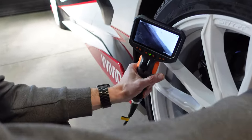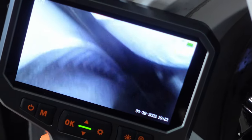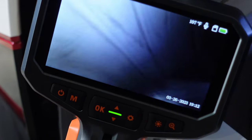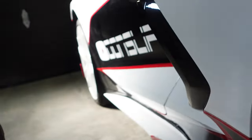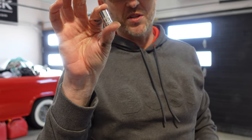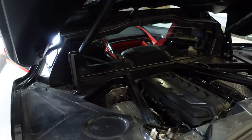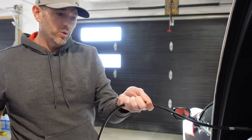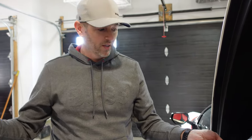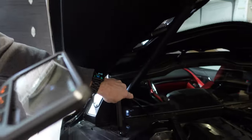If you don't have a hoist or don't want to pull the tire, checking your brake pad life is a good use for a borescope. I can see the pad up against the rotor — nice and thick, just like the front one. These are new, but it's something I can keep checking with a borescope. Here's a 10-millimeter socket — we're always losing these in engine compartments. This car has under trays all the way along, so if you drop something, you can fish the borescope down to the under tray, look around, and figure out which panel to remove or use a magnetic stick.